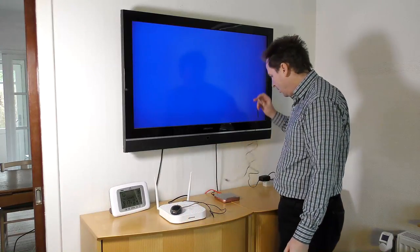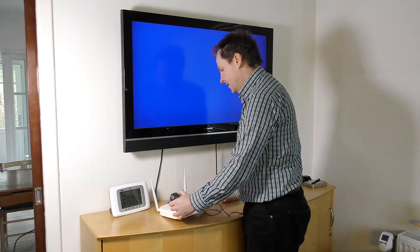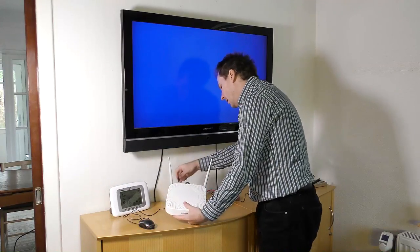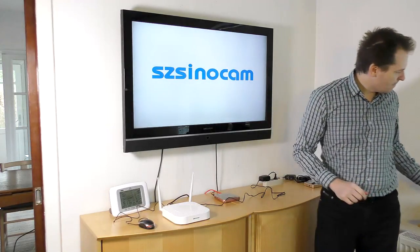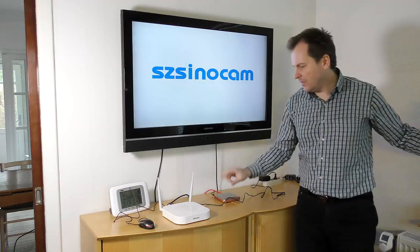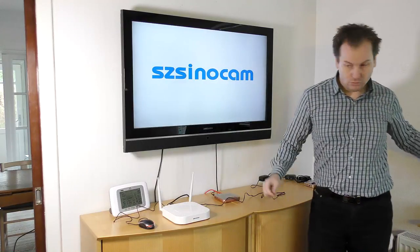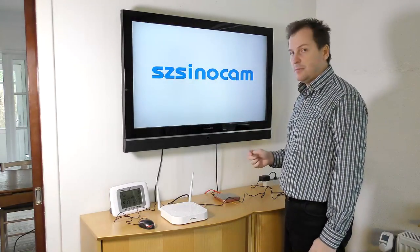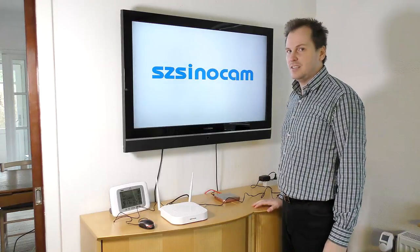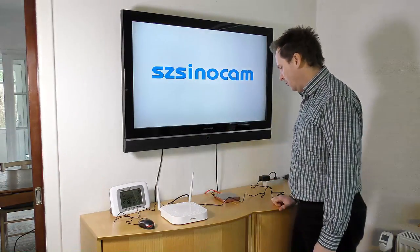And also, I have plugged in the power adapter for this one. So we're gonna plug that in, and try and get all these cables in the right direction. There, power has been plugged in. It says a beep, and then there is a splash screen. My TV was not able to run this the first time, so I actually had to connect this small newer monitor to change the TV resolution of this box. It was set to 1280x1024 and the TV just didn't like that. So I've been in here and I changed it to the full HD of what this TV can do.